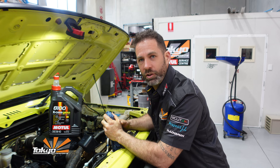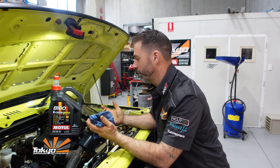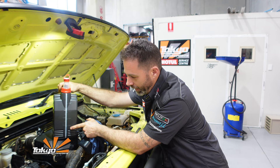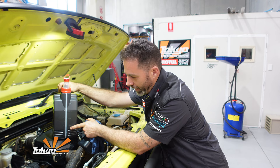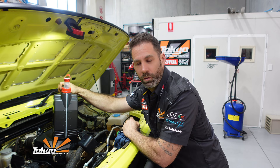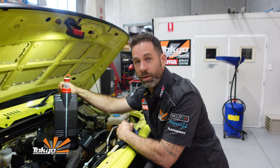Oil's all in. Just be aware to check how much oil's going in the car — you don't want to overfill it. It's just going to waste oil and spill out through the rocker cover and into the breathers. If it's super full, you might get crank splashing and that's no good for the bearings. On the side of the Motul bottle there are little level indicators so you can get the correct amount of oil into the engine. The last thing we need to do is fire the engine up, which fills oil into the filter, then turn it back off, let it rest for 30 seconds to a minute, dip the engine oil, and we should be bang on the money.